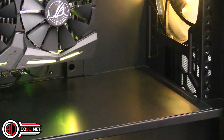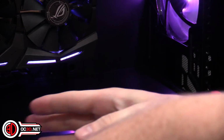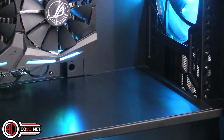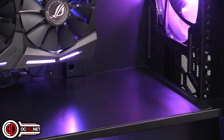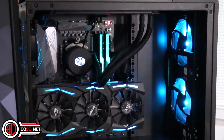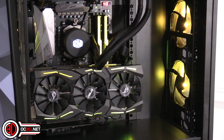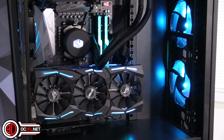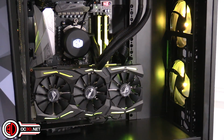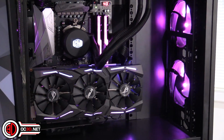It's plastic basically. It's something called Plasticard. You can get it off of eBay. If you wanted to make one for the bottom of this case, and you've got one of these cases, an A3 sheet is fine. You can cut it with a pair of scissors, just mark it out. Now what I did is I made the cover for this, and then I also made a cover that goes right the way up the back. Again, same stuff, Plasticard, just cut it. It's double-sided tape stuck in, really not hard, but it cleans all the lines up, because where this is, there should be a cutout that you can see through to the back panel, and the wires for the fans come across here. It's just not pretty, so I tidied it all up.